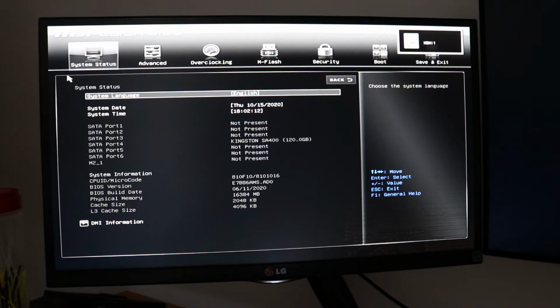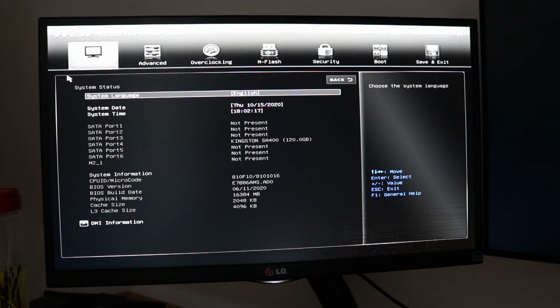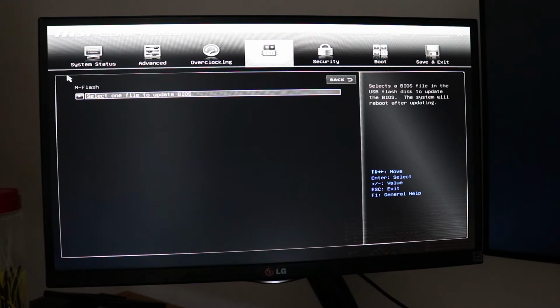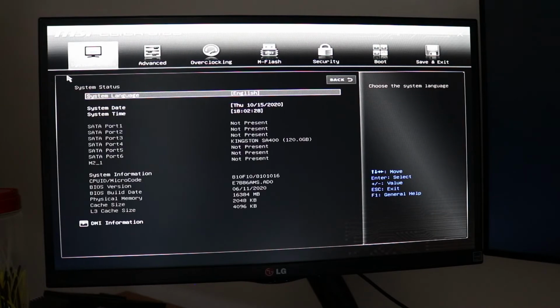and there we can select which drive we want to boot from, and we're going to choose the USB. So I'm going to do that now for mine. We're going to turn on the computer and try to get it to boot. So as you can see, that got us into the BIOS here, and this is what the MSI BIOS for my motherboard looks like. Yours will probably look different to this depending on the make of your computer or your laptop, but this is what my specific one looks like.